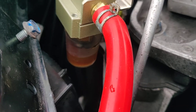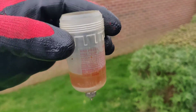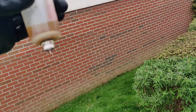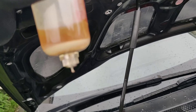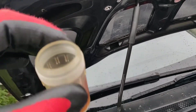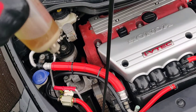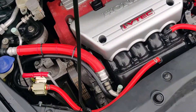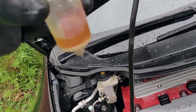I'm about to take this off — it's clean oil. Okay, so that's the collector off. There's some kind of white misting on the bottom. There we go — yeah, it's some kind of white misting on the bottom of it. This is not oil that's going to be going back into the car. I'm going to get rid of it and give it a clean. But this has come out of the PCV valve, so yeah, definitely doing its job, which is collecting the oil. I am impressed with that — quite a lot of oil has been collected.